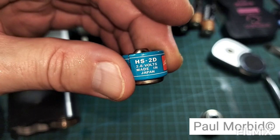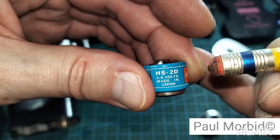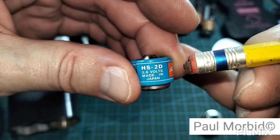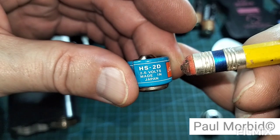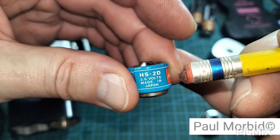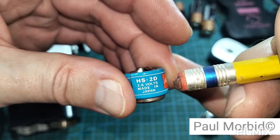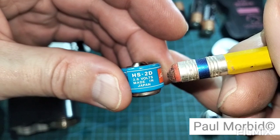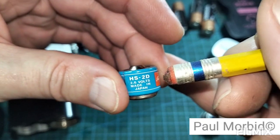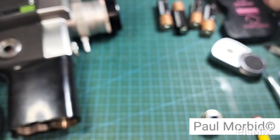And here you have it, if you ever wanted to know what the voltage is, 2.6 volts. The equivalent batteries are going to be slightly higher. You'll need to use a handheld exposure meter or one in the app online. Some are free, some you have to pay for, to get the proper exposure and run a film test. Just the way it is when you're using these earlier cameras.